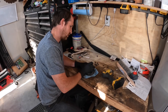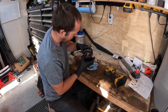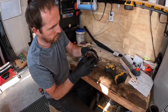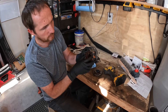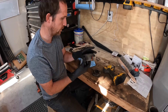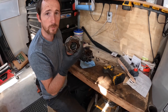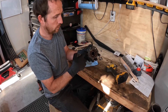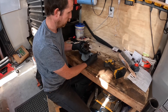It's easier to do when it's off the vehicle. See, it's stuck — it won't even come apart. Look in there, it's all full of goodies. That spring pops out. So basically what you do is pull the face off and clean out all the gunk in here. If you do it off the vehicle, don't lose these cone washers — they're impossible to replace.